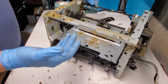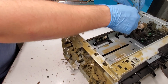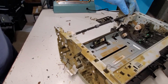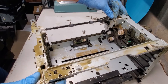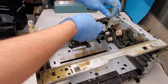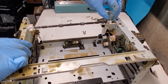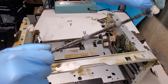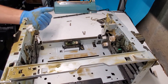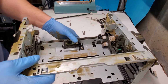But anyway we got this all taken care of. This is the exit roller — to remove it, just move it like so, it goes right here. You just move it this way and out. So this is replaceable, and you can always clean this too if you're having paper jams at the exit or the paper is not being fed — just clean those rollers without taking them off and you should be good.